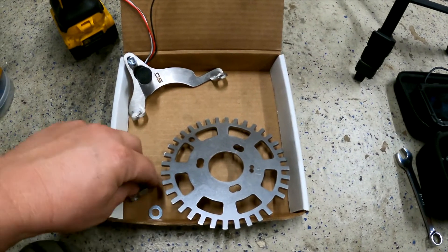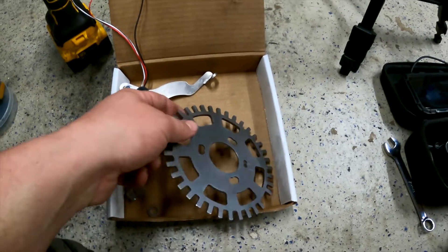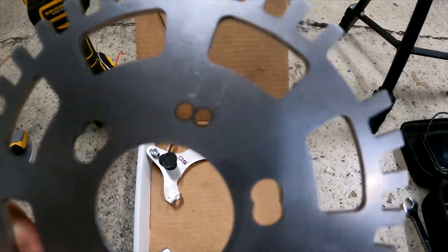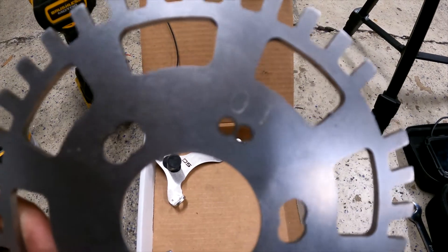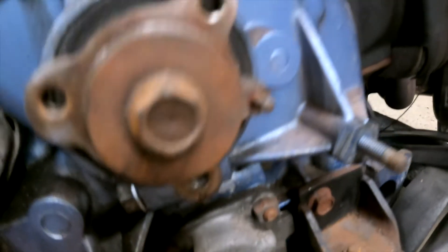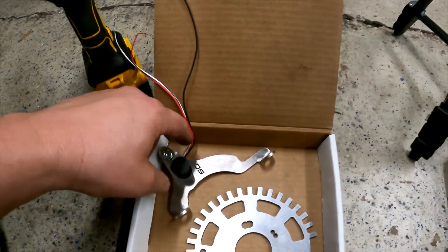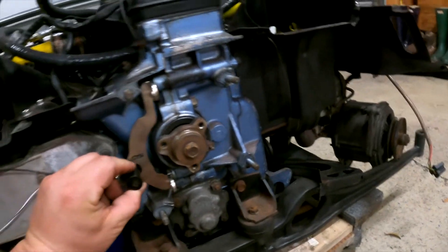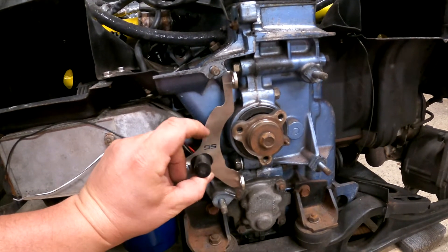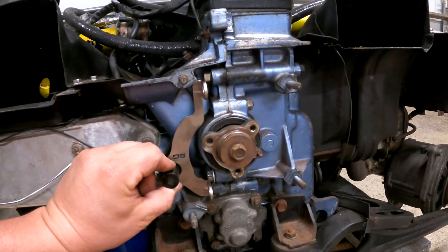Here's everything you get in the Dub Shop kit: some washers, special long nuts, a bracket, the sensor, and the crank trigger wheel. The trigger wheel has two positions — zero and one. They list zero for Haltech and one for the Dub Shop kits they put together. I don't yet know all the differences, but we're going to put it in the zero position on the locating pin on the crank hub. This bracket goes just like that — we'll take off the two 13mm nuts, slide this in place, bolt it down, line up the sensor with the trigger wheel, and then try turning the engine over to verify the signal.